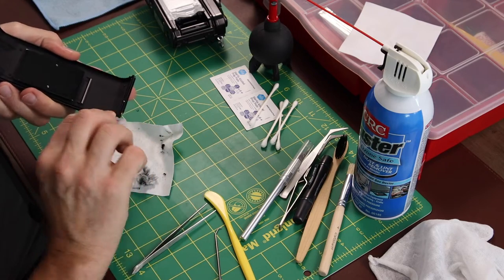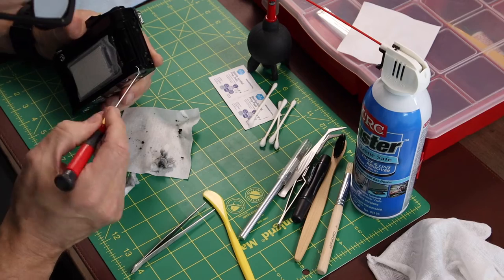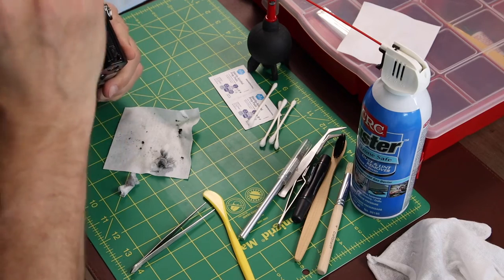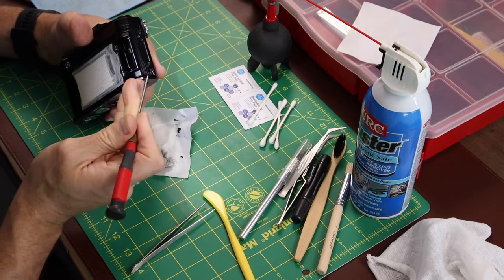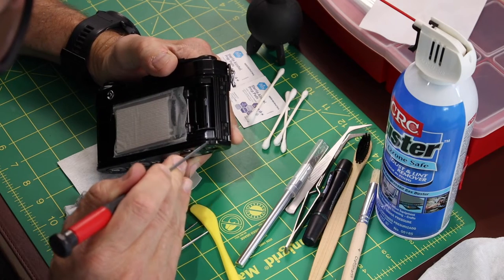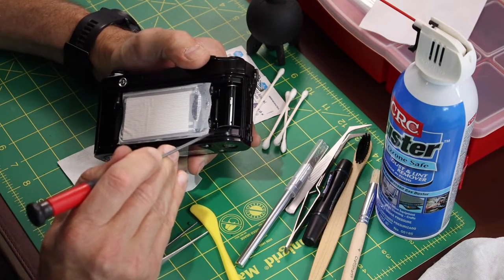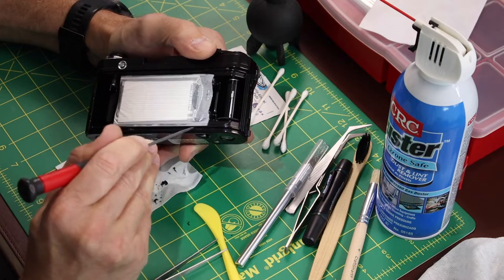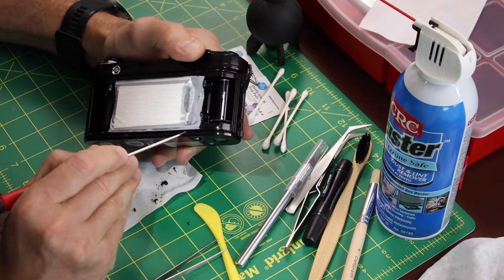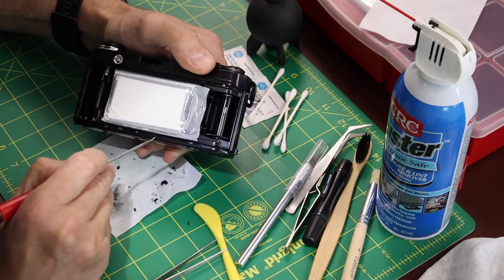The edges of the door are often forgotten, but there's a lot of sticky residue on there. Sometimes it can stick to your seals after the project is complete and pull your seals out of the body. So clean that door off. These dental tools are really handy for picking out the old seal — the old seal sticks really well to the door. You want a clean surface so your new seals can go on and stick well.